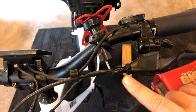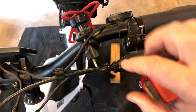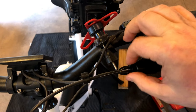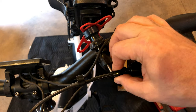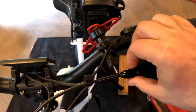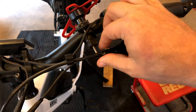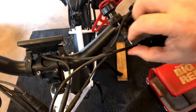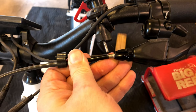This is the barrel adjuster right here. You have a lock washer here and the barrel adjuster here. The way this works is you loosen this up by twisting it counterclockwise when looking at it from this direction, and then you loosen it all the way up until it's tight with the barrel. Then you tighten it by going the other direction — tighten the barrel back in so there's no gap. What this does is it makes the cable loose, and you can actually pull it out some, because it's now loose.